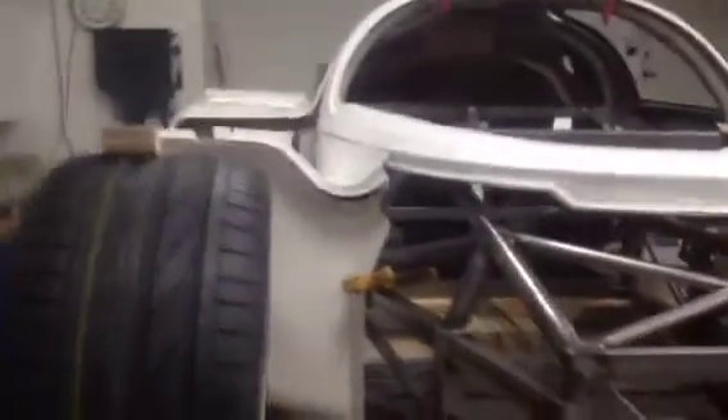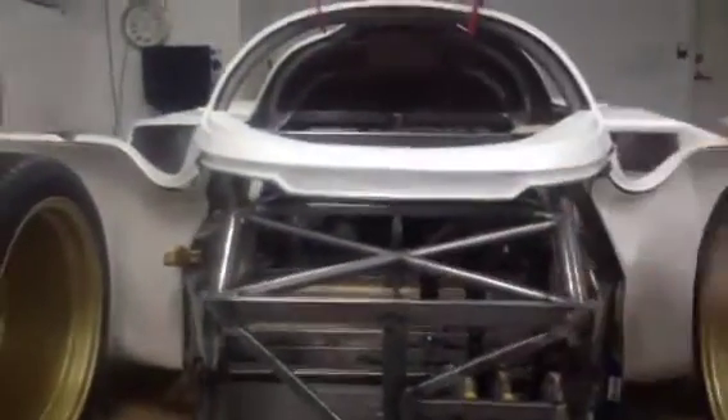The other side is within the realms of adjustment — a little bit of fibreglass cutting, it's a little bit high but not far off. That side is almost a spline, a near-constant curve — as long as you can bend something into a natural shape it's generally okay. That side references well for correcting this side. But the right-hand side is just completely out. It looks like I'll probably have to sectionally chop the back into more than likely three pieces and line it up.